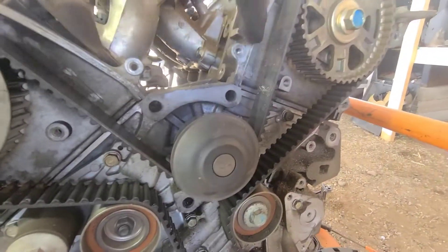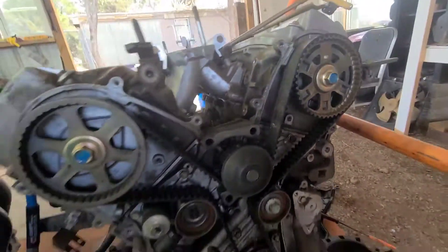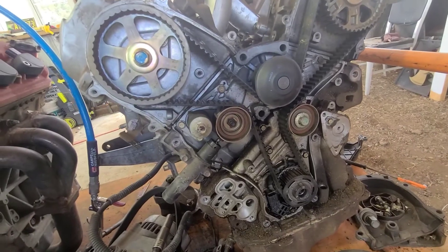We're going to have to switch out the wheel and the sensor, then come up and take the cam gear off and take this whole plate right here — because if you could see in there, the sensors are kind of integrated into the plate itself. I just wanted to show you guys the reluctor wheel and the sensor on the motor before I started pulling this stuff off.